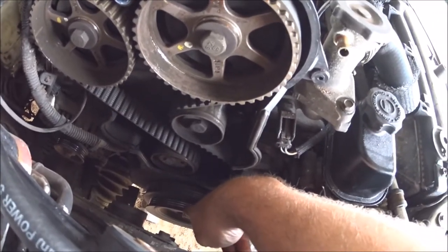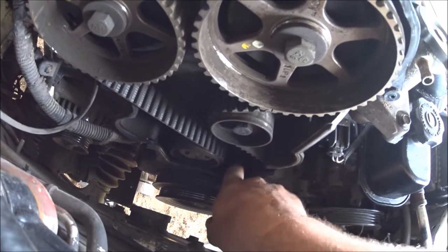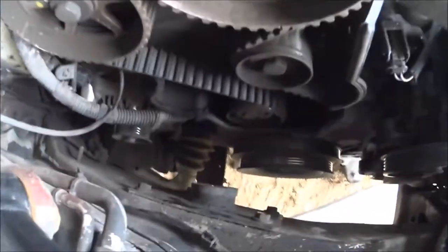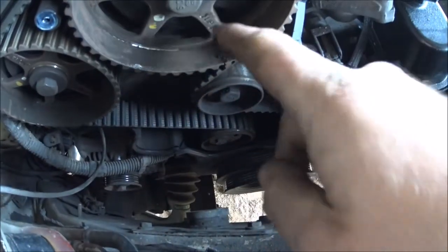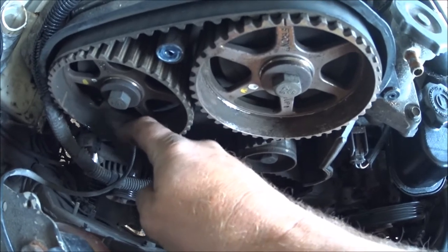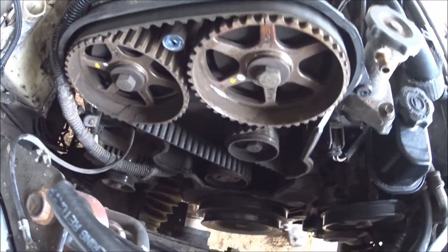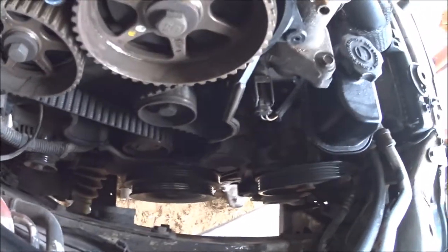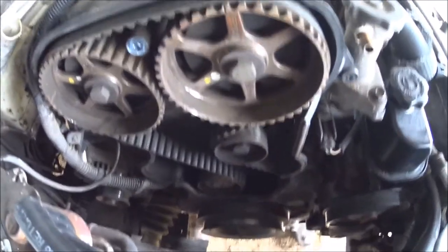We got down here and started rotating the crank — stuff moved a little bit and then came back around. We found we had teeth missing off the belt, because it would get to that one spot. You can see threads on the belt and there's all kinds of belt debris in here — this is probably the original belt. The mileage is unknown on this motor because it's not the original motor for the vehicle. We're going to put everything back in time after we pull the lower crank pulley off, and hope nothing got damaged.